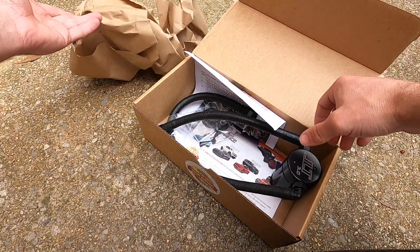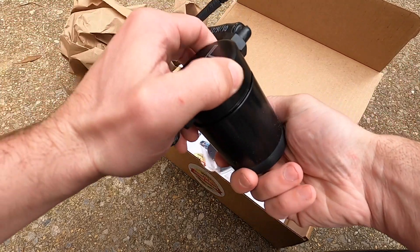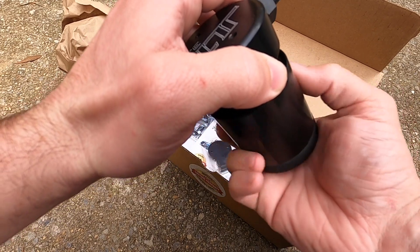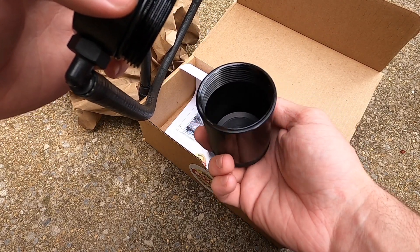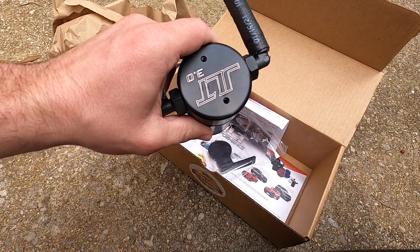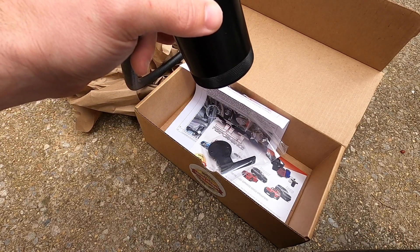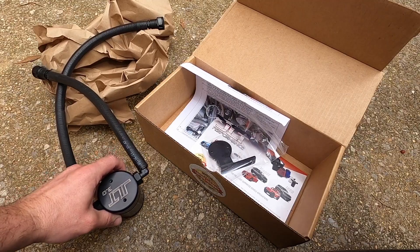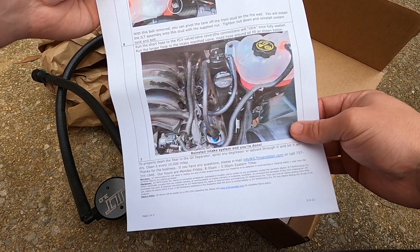This should be a super easy install. There's our kit — I'll show y'all. You're basically just going to check this whenever you check your oil. I mean, you can check it more often if you want, but I've had these on several Mustangs and they've worked very well. It essentially just collects all the moisture and unburned oils and crap, puts it in here, and then you just empty it out so it doesn't get circulated back into your engine to build up gunk. These things are super helpful if you plan on keeping your vehicle for an extended period of time. If you're going to keep your truck for a year and then sell it, probably not something to worry about — let the next guy worry about it.